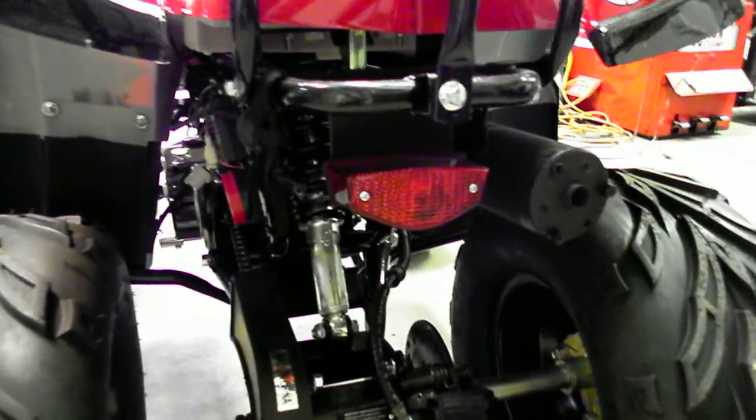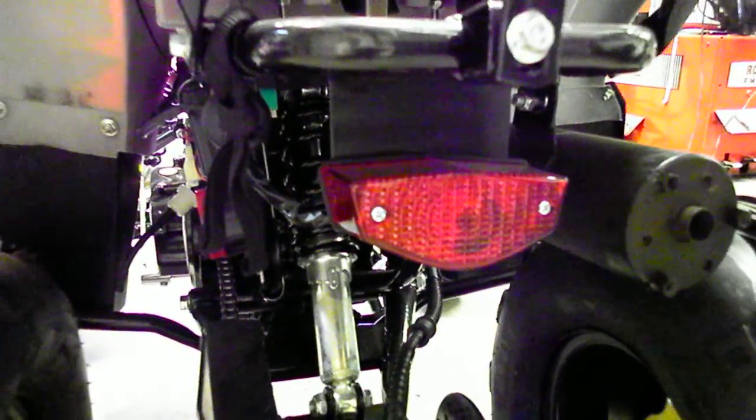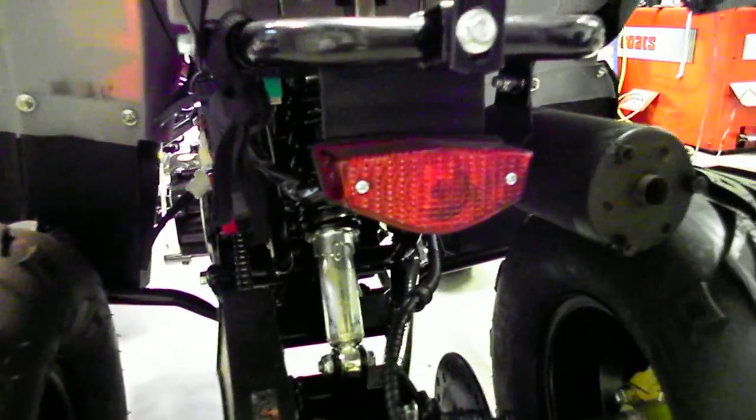One of the other things we did — this is actually an American-made taillight assembly. It's a lot higher quality and a lot brighter. You have to drill some new holes to install it, but it's a light that's under $20. It still takes a regular 1157 bulb.